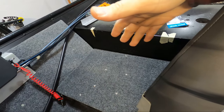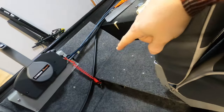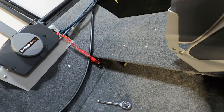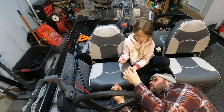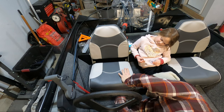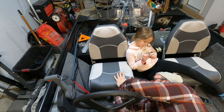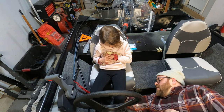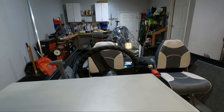I have the holes drilled out and some bolt placeholders in place. I have my mounting bolts ready to go with washers on them. I'm going to do the same thing with some anti-seize on the bolts just to make sure nothing rusts out if I need to remove this stuff. Pretty much the same process — let's hope this all lines up the way we're hoping for. Okay, the driver's seat is now installed.